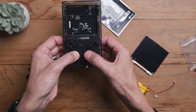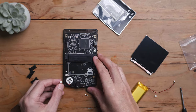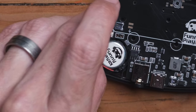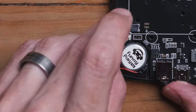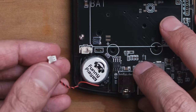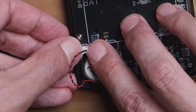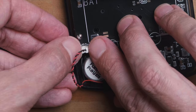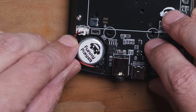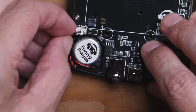Inspecting the buttons — already falling in love with the device. Now we want to plug in the speaker. This cable will annoy you — just make sure you line it up. There's only one way to put this plug in, but the contact points need to be at the bottom side of the plug with the notches on top. Slot that in until you feel a light thud and resistance — you know it's firmly in position. Then tuck away that cable. It might just spring out no matter what you do. Once you put the back plate on, just make sure that cable is not crimped in any way.